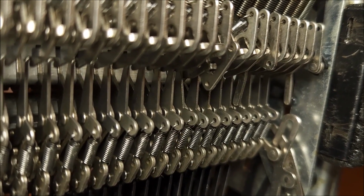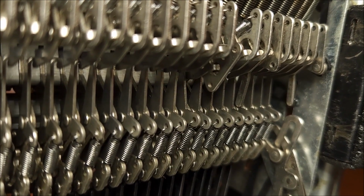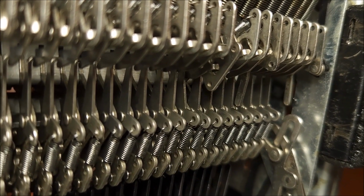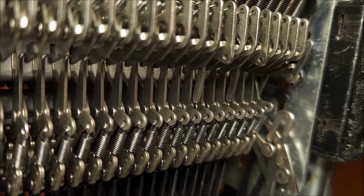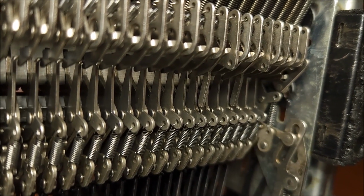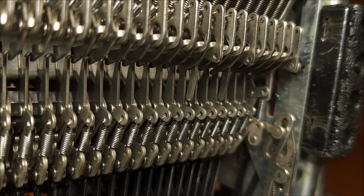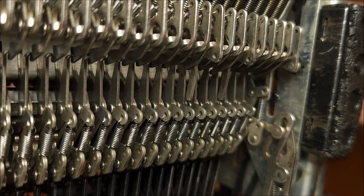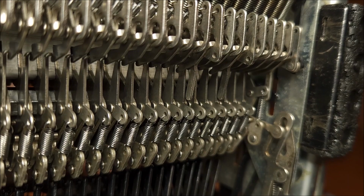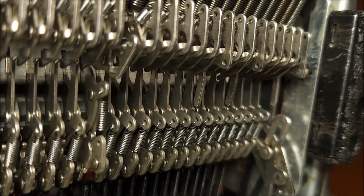So here, as I wind this, I get a repeated dot. So you hold it down and there you go. Same thing with the space. If I hold it down, it's just going to keep moving. Now later editions have, the 6 series has an option of a single space and a power space so that you don't accidentally multiple space if you press too hard or you dwell too long on the keys, which is a problem sometimes.